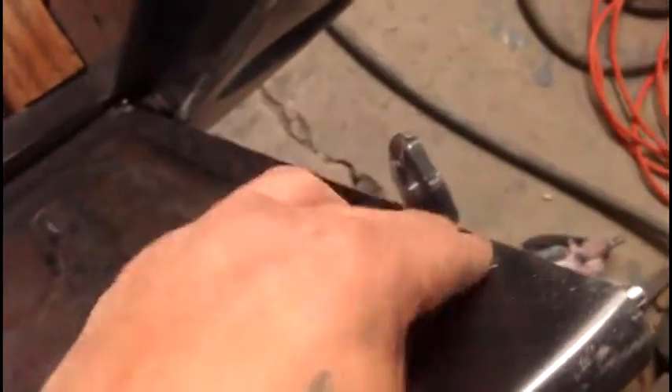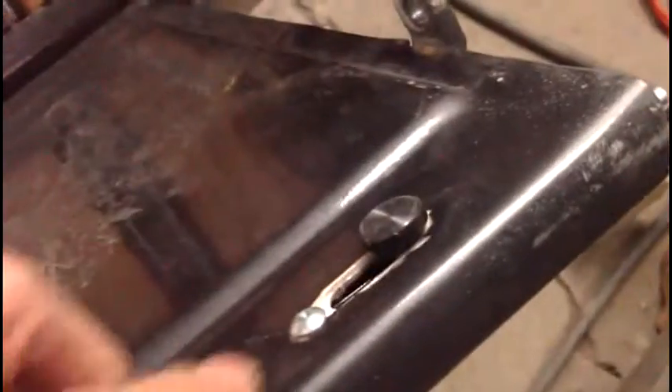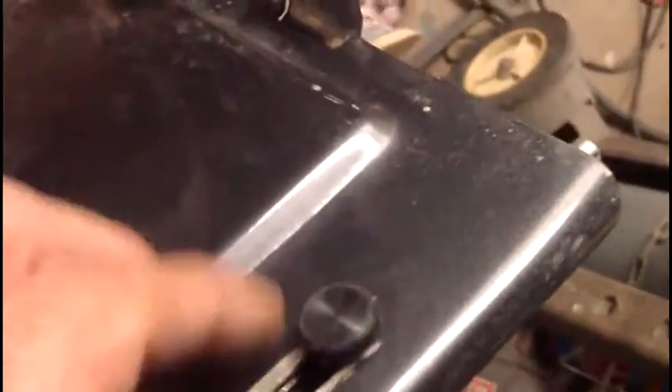But that's what we were doing when we were cutting all this stuff apart and getting it the way we wanted. We're going to have to probably repaint this whole inside of the tailgate — it's kind of beat up, it's been just sitting there for a while since we've been working on everything else. But it's no big deal — gives us a chance to take some of the dents out. You can see how I welded up all that stuff there — it's ready for Bondo.